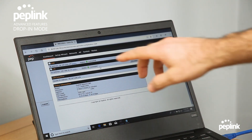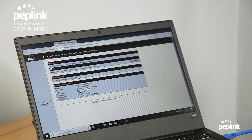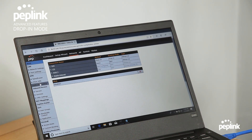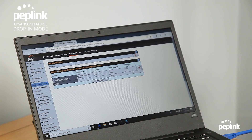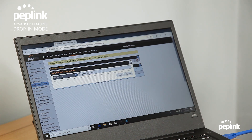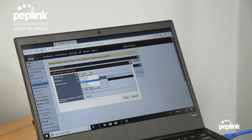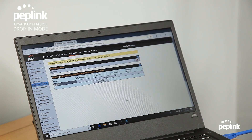You'll see that I'm in drop-in mode. My primary IP is online, my LTE is online, and I have the router. I'm going to make one quick outbound change to prioritize traffic over the drop-in mode circuit, since LTE is slower than a high-speed internet connection. So drop-in mode is primary, then use LTE only if the primary circuit is not available. Hit apply changes.